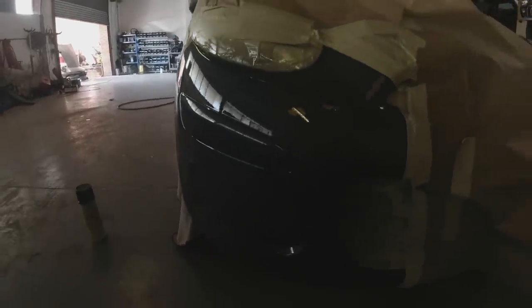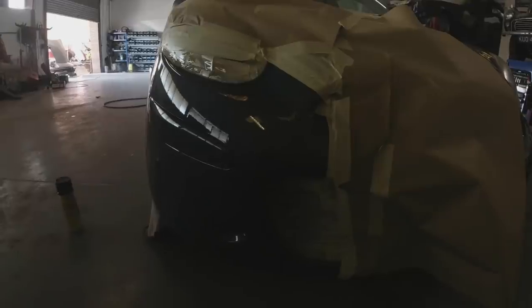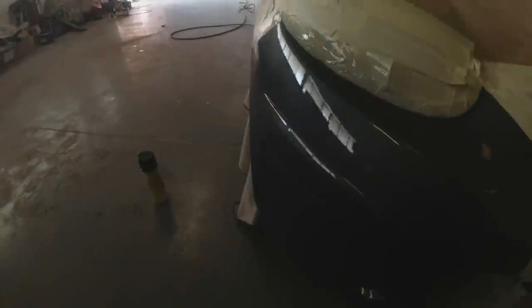So you've got your fade-out thinner on the edges of where the lacquer is. You've put the lacquer on in a heavy coat this time, so hopefully we can just buff this and it'll be in good enough condition to not have to do it again. But yeah, for the moment we'll leave it alone - do not touch it.